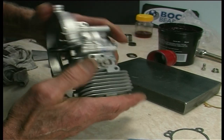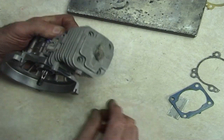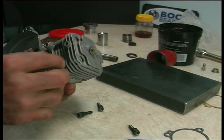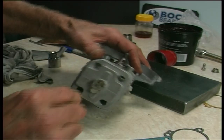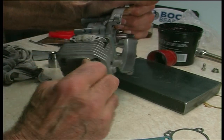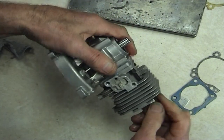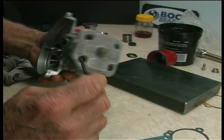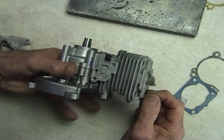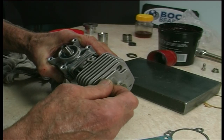Line up and straighten your gasket — inlet, inlet. Put our four cap screws in and just nip them up by hand from corner to corner. Basically nipped up there. Now get your special extension tool. Just a quick nip — not too much, not too quickly, that's the big secret, so it doesn't distort or warp the housing at all.